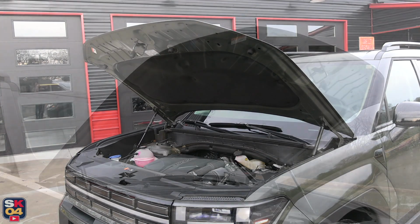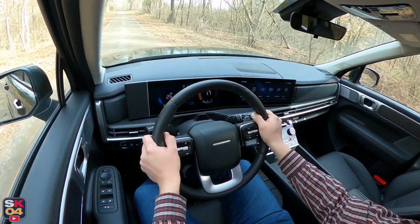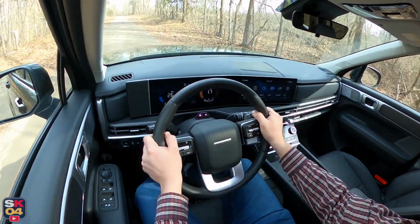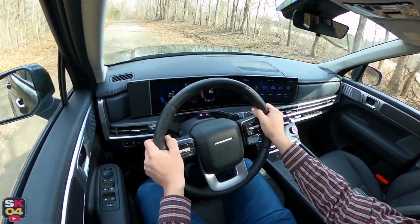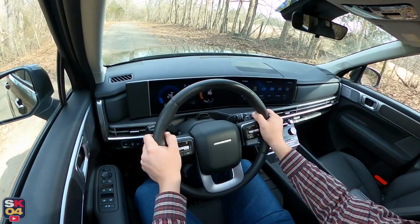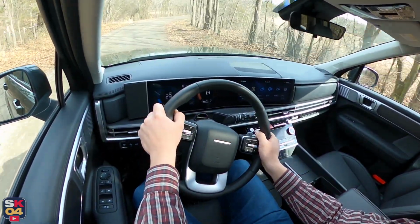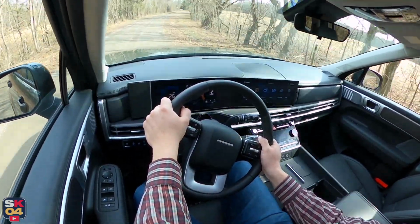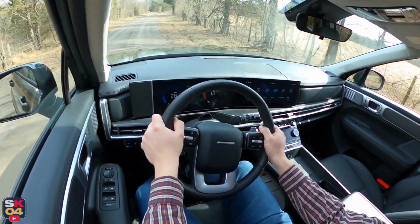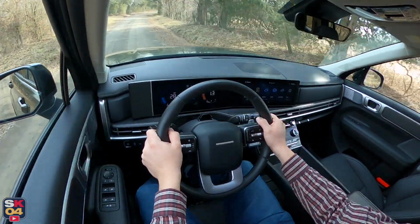The all-wheel drive system has a wider range of torque distribution variability than many competitive systems, and has been tuned to conditions such as straight-line acceleration, medium and high-speed cornering, and hill starts. The 2.5-liter engine is built using aluminum construction, double overhead cams, 4 valves per cylinder, and continuous variable valve timing. Fuel is delivered by a combination of direct and multi-port injection.